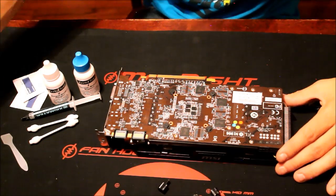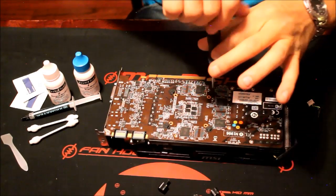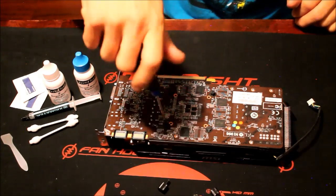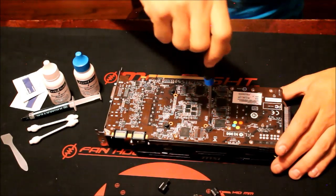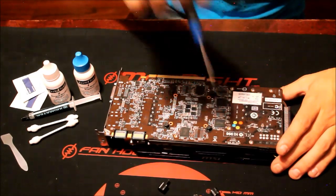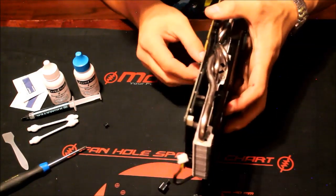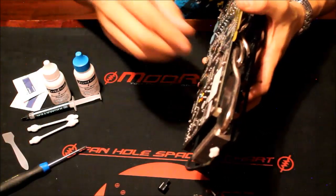For this you're going to need a small Phillips screwdriver — not super small like eyeglasses, but pretty small. You're going to want to follow what I call the cross-diagonal pattern. You don't want to completely unscrew everything right away; start in one corner, move to the next, unscrew it most of the way, then rotate around in a circle like you were changing a tire. The part you have to be careful with is when you actually undo all the screws and pull them apart — just be gentle. It's a $400 video card. Take your time, undo the screws, and slowly pull the two apart. Sometimes it helps to heat up the video card ahead of time to get the thermal paste loose and ready to be pulled apart.